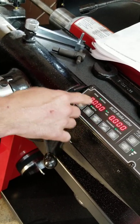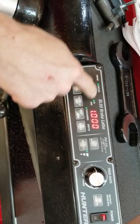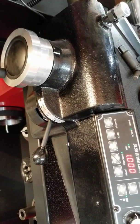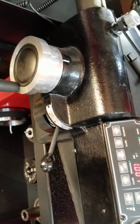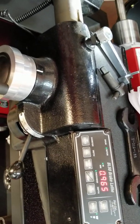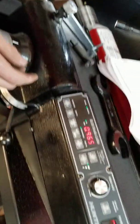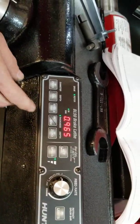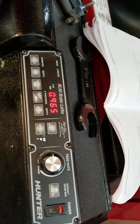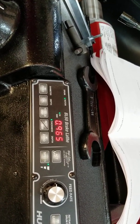So right now the display shows rotor thickness — that's what we're doing. If you're cutting one, you know that's where you started, and you run it in and you can know how far you've made it in. You can use this to measure a rotor — basically to measure the thickness after we cut it, right? Yeah, you can measure it. You measure before you cut it to make sure how many thousandths you can take off.